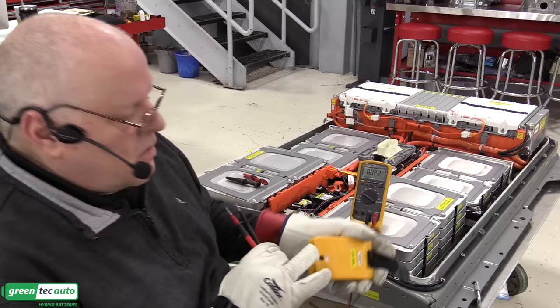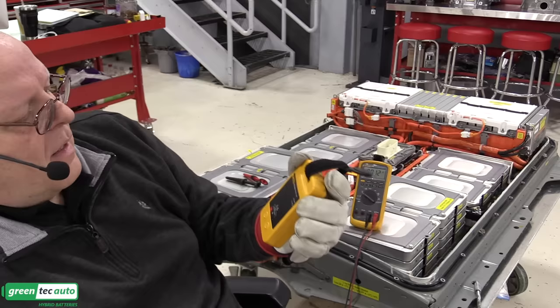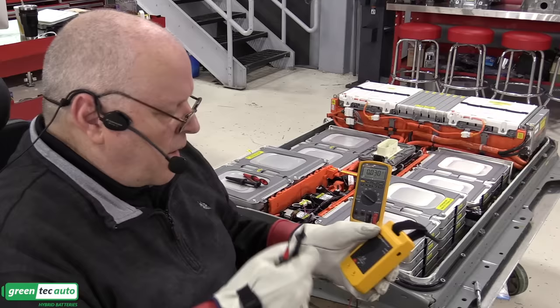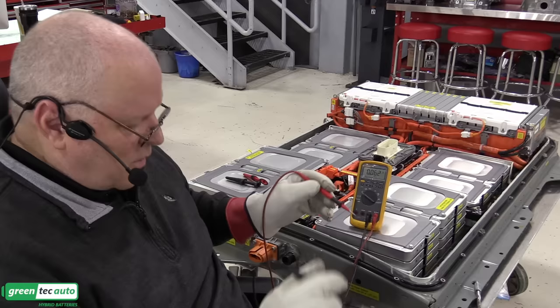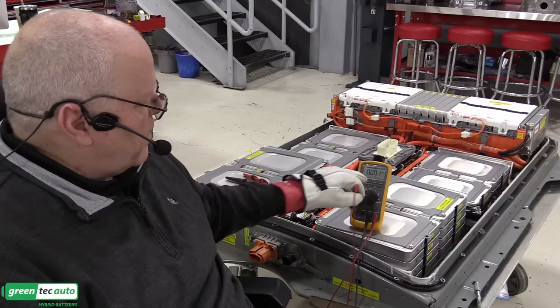So the best thing you can do is test it on another battery, just a 12 volt battery, 9 volt battery, whatever. Fluke does sell what's called a proving unit. I've got one of these right here. It's part number PRV240, and it will put out around 240 volts DC and AC. There's a switch on the side. I've got it on DC right now. But if I take my multimeter leads and press them down on those two terminals, I should read somewhere around 240 volts, depending on the state of charge of the battery in this proving unit. But looking at the screen of my Fluke 87,